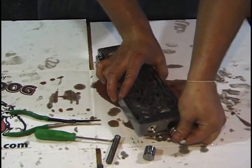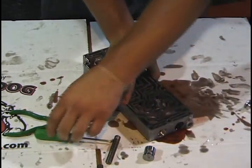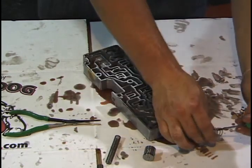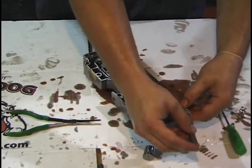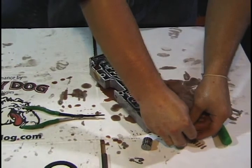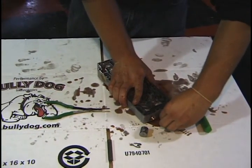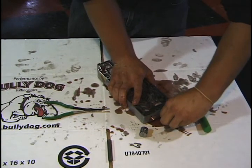Simply continue to do this on the other 2 valve bodies the exact same way by using the 1/4" bolt to pull the shift plug and placing our spring inside of the existing spring and replacing it back in place. Do this to all 3.